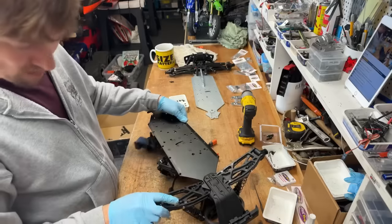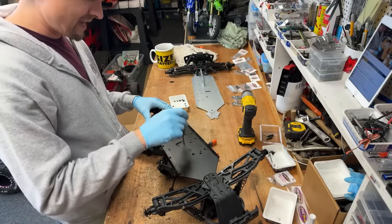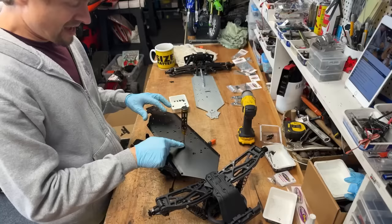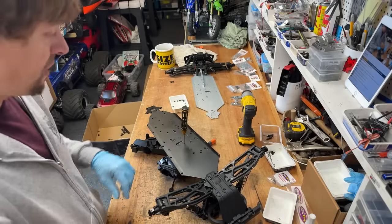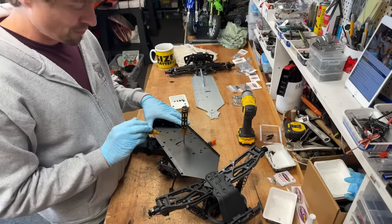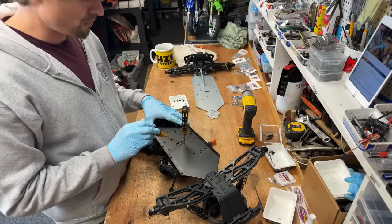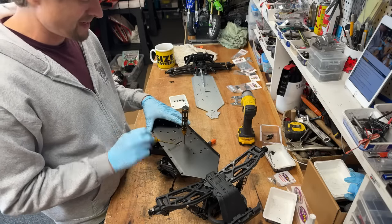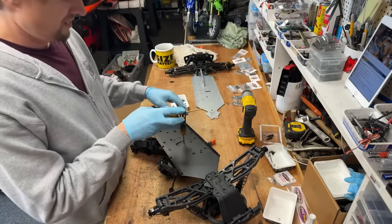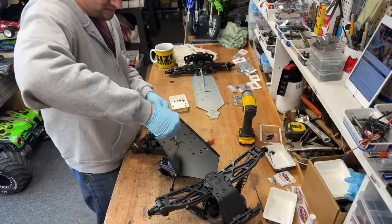Motor's got to come out as well. Now what I'm going to do on the motor, a lot of these are Loctited in, so I'm going to go ahead first, get that on there and break them off by hand. If you go straight in with the Ugga Dugga, you run a risk of stripping off these hexes. And by the way, if I do strip these off, that'll be the end of the live, because I'm not going to mess about doing them live. It's going to be drilling and messing about, and oh my god. That'll be on a different day. So hopefully they'll come out.